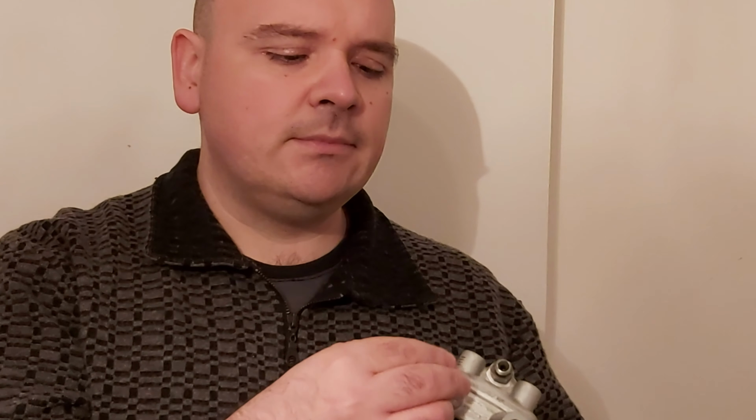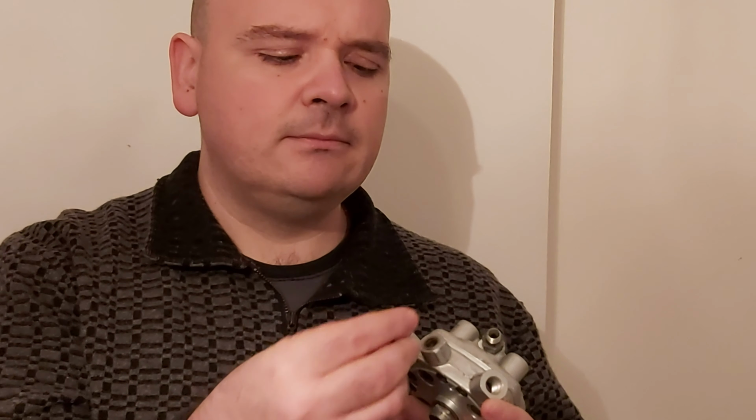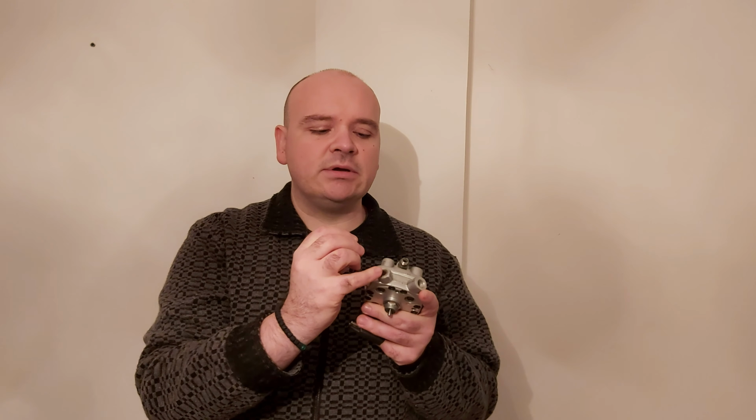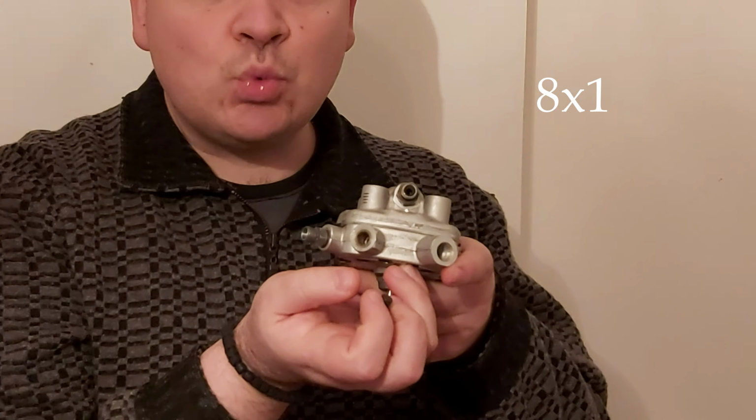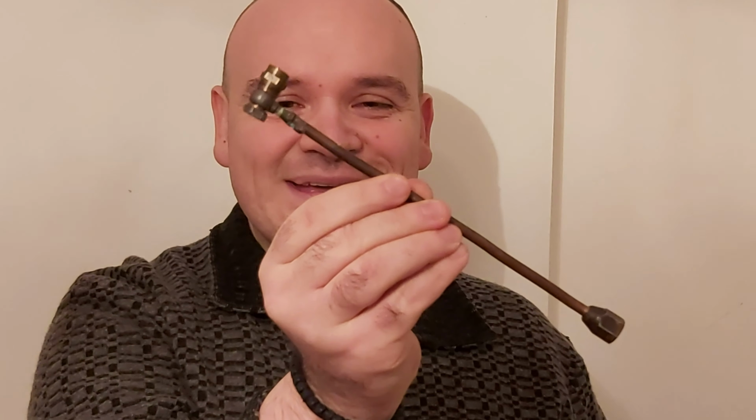Concerning the working pressure, as I've said already, it's measured here. Well, if we unscrew this one, let me tell you about the thread here. We have an aluminum washer here also. So you must know that the thread here is 8 times 1, if you decide to do this yourselves to make the adaptation. Let me show you mine. This is it. This is what my friend mechanic made for me as adaptation to the pressure gauge,